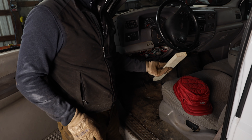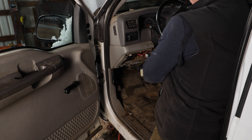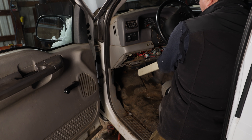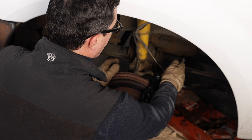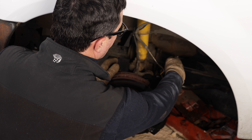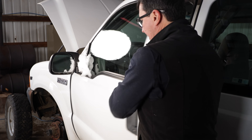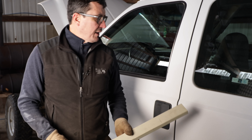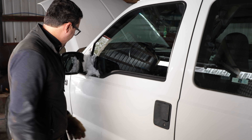What I do when I'm doing this by myself: just cut yourself a stick that's long enough that you can fully depress the brake pedal and then jam it either under the steering wheel or on the seat. Do that a dozen times or so and you should be able to get all the air out of the system. Simple trick that my granddad showed me years ago.